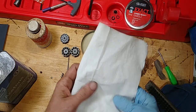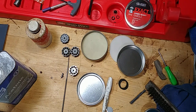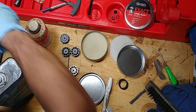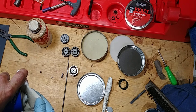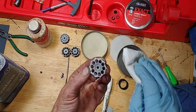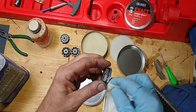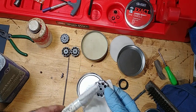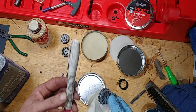I'm pretty old - I've had all this stuff on my skin. Not like nowadays where mechanics have gloves for everything. We didn't have that back in the day, and we didn't wear a breathing mask either when we painted. I'm just going to take the acetone and clean this all up - it gets rid of all the oils and everything else. Now, if you were to use a paint pen marker, this would actually put a build on here. And if it gets in the holes, you're going to have to start over or have buildup on the sides. So the marker I stay away from.